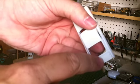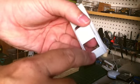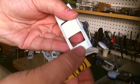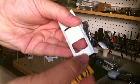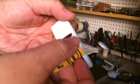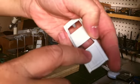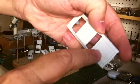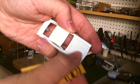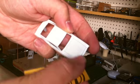And see how there's a little piece of trim there on the trunk? I'm not going over that trim. If you do, the raised areas, you're going to knock the primer off. If you want to sand those raised areas, you're going to have to go back separately. Like, see, there's a little raised piece there on the hood. So all I'm going to do is just treat each flat surface separately.